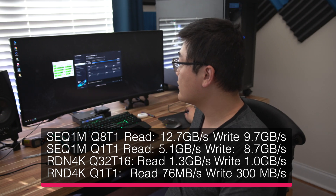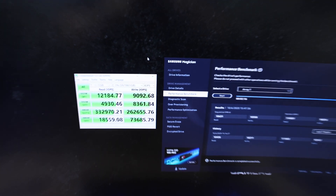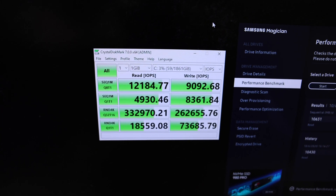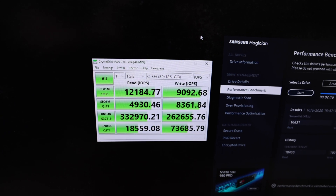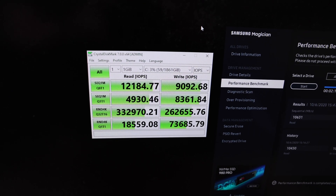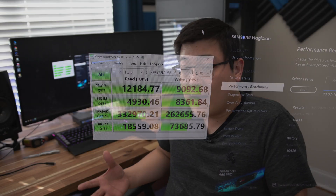Tapping over to IOPS, it's basically a similar story — the IOPS for sequential 1MB is about double. The IOPS for 4K is about 300,000 to 260,000, which is down from 600,000 on a single drive — so about 40 to 50% of a single drive. So you get some pluses and minuses.